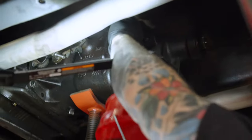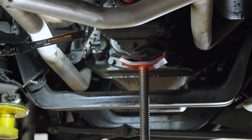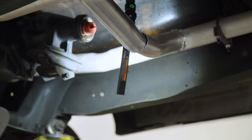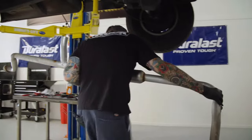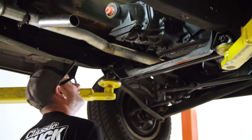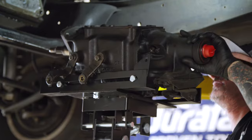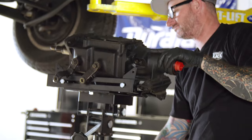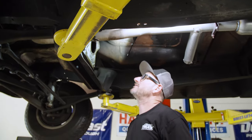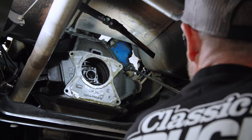We'll start by pulling the speedo cable out and undoing all the linkage, then pull the surrounding bolts holding the transmission to the bell housing. I'm going to go ahead and get this exhaust out of the way - it's going to make life a lot easier. That gives us all kinds of room. Let's bring in our transmission jack to pull this out - they're not that heavy, but I'll take the assistance. I put a piece of wood in between the head and the firewall just to rest the engine on so it's not floating there. I use this extension when installing or removing automatic transmissions because it gets me way back in there.